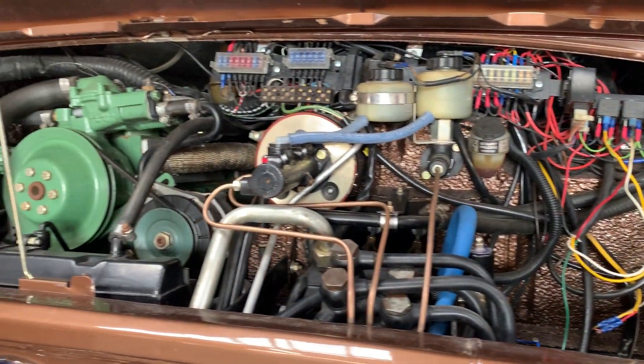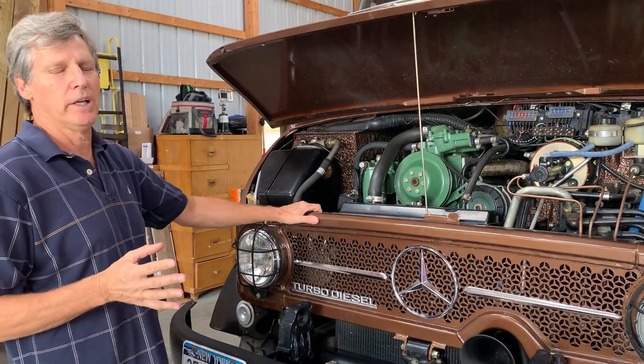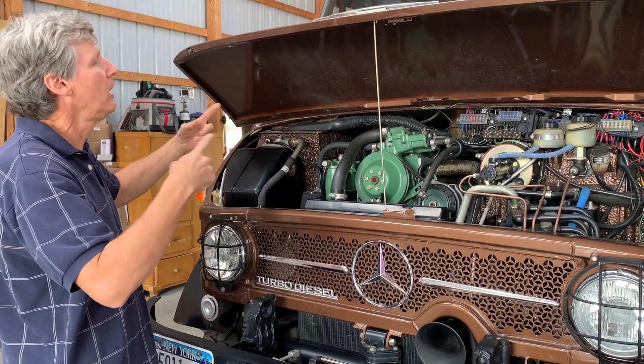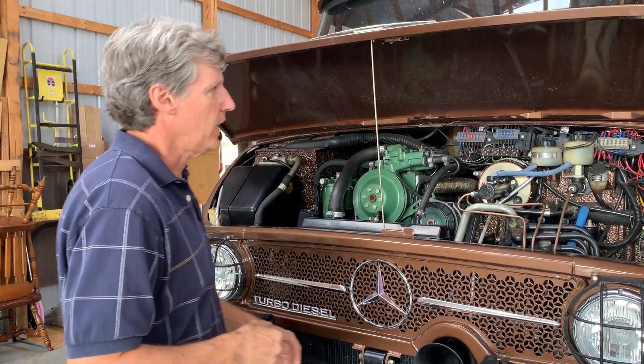You can see the texture in here — all back in there is truck bed liner. We sprayed the whole inside to quiet it down. When the truck was painted it was done on a rotisserie so we could paint the bottom and the inside first, then paint the rest of the truck. Same with the frame — everything was done on a rotisserie.